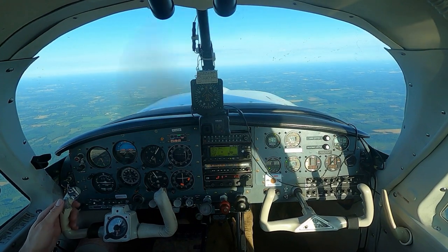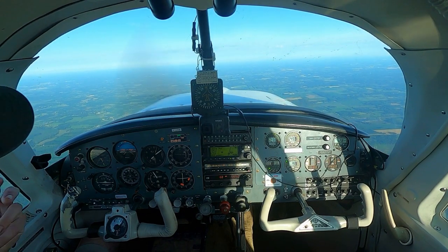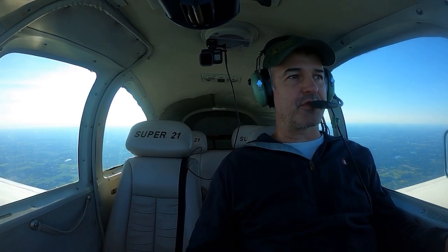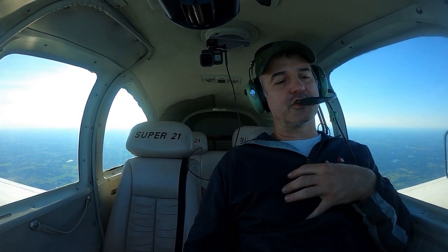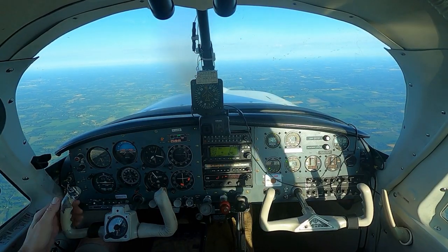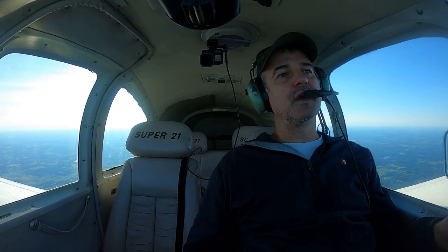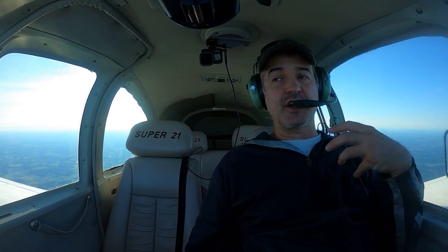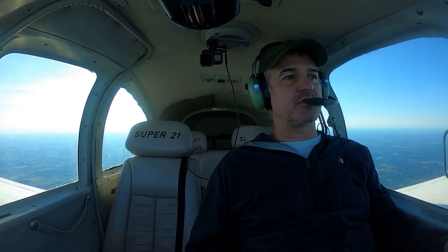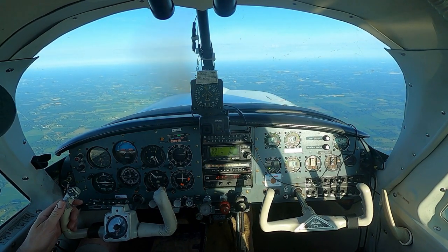If you wanted to do an experiment to see for yourself why this is, try taking two deep breaths as fast as you can. Say the first deep breath is with your mouth wide open, and this would be like a wide open throttle. If you do that, you'll notice there's very little resistance on your diaphragm for pulling in that air. But if you do it with your lips kind of puckered, with a small opening at your lips, you'll notice there's a real tightness in your chest, and it's actually really hard to pull the air in. That's what happens when the piston's coming down against a closed throttle. That will slightly slow the piston down and take power out of it.